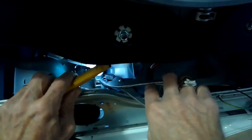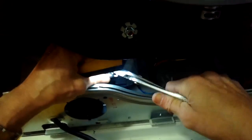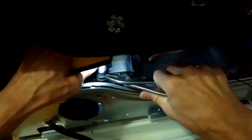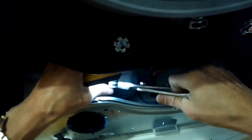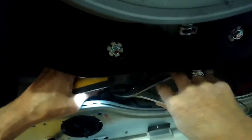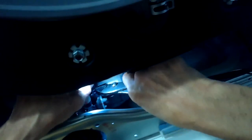I'm going to use my pliers to press in on these hose clamps and lift these two tubes off of the circulation pump. I'll keep track of which one's which — there's one marked with red and one marked with blue. The red one goes toward the front and the blue one goes in the back. So get those two off.